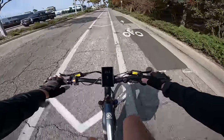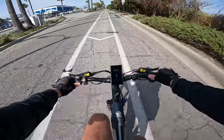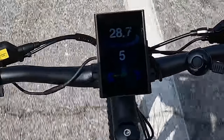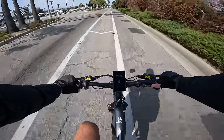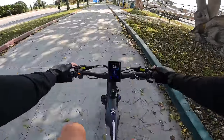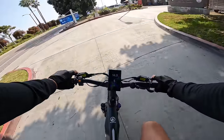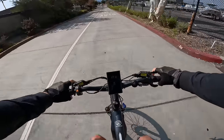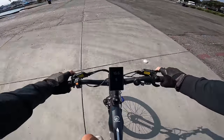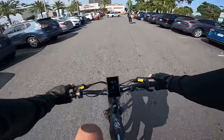Riding with a tailwind, let's see the maximum speed. It's bringing us to 28, 29 mph, showing 700 watts — so it starts to cut power delivery once you get up there. That's pretty much what you can expect from any 48-volt bike. The front suspension is very basic, but as long as you're not doing actual mountain biking, jumping, or expecting top-tier downhill performance, you'll be happy with it. It just makes the ride a little nicer so you can go over things — it's not awful compared to a bike without suspension.